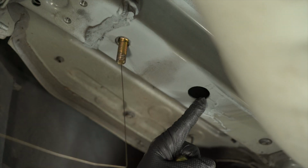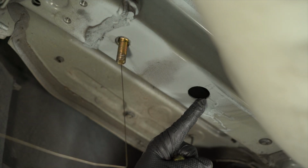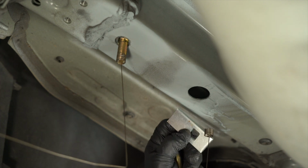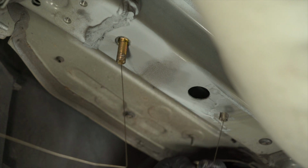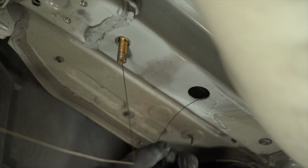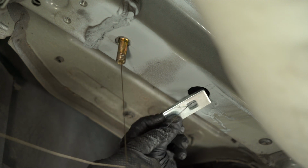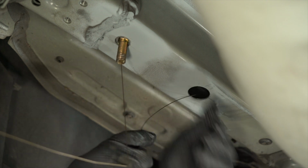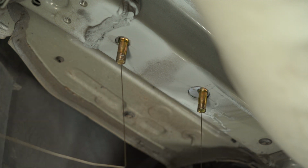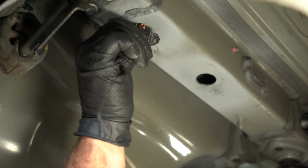The forwardmost mounting and access location will get a reverse fish wire. Place the spacer first on your wire, then thread on your carriage bolt, then pass the hardware into the frame, and then pull it back out. Repeat for the other side.